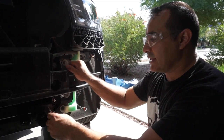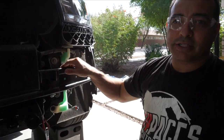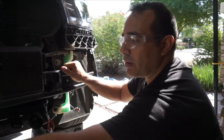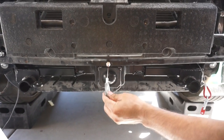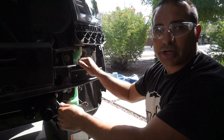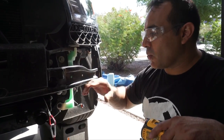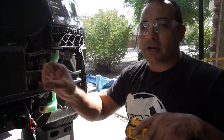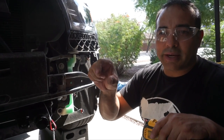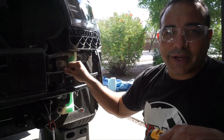Per the instructions, the emergency cable should be zip-tied all the way along, and when attached to the brake pedal there should be three or four inches of slack, so when you push the brake it just bends the cable rather than pulling on it. The main cable will actually move when you press the brakes, but the emergency cable should have slack so it doesn't push on that side. Our pedal has an extreme bend in it, so we can't use the standard clamp. Install videos show drilling a couple of holes in the pedal and tying off the two cables near it - that's what we'll do.